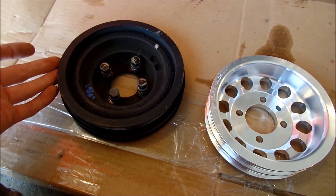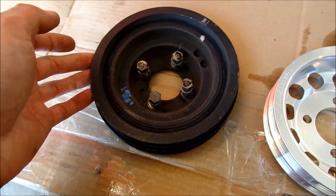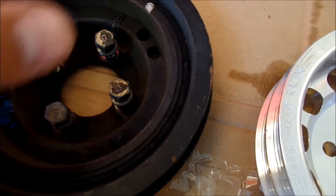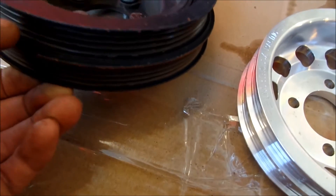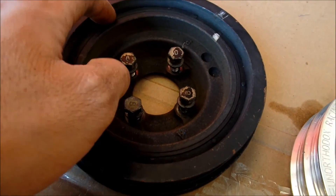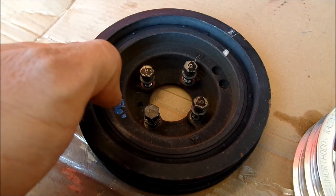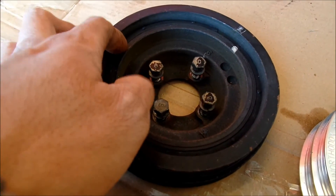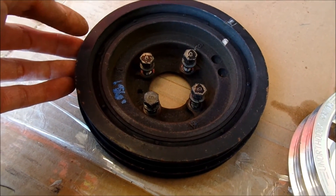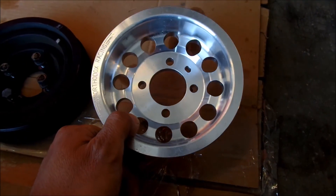My 428 never had one, it just had a crank pulley and not a harmonic balancer. You can see there's pieces of rubber, a rubber insulator here, and that's what holds the pulley section - the one with the grooves for the belt - to the actual piece that connects to the crank. This is the dampening part. The bad thing is that over time the rubber deteriorates - see this one's getting hard but still in good shape. It can cause it to separate, which can't be good. So we just eliminate it with this one solid piece of aluminum, very well built.